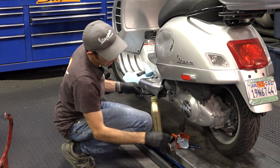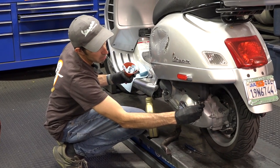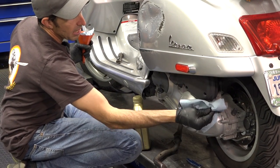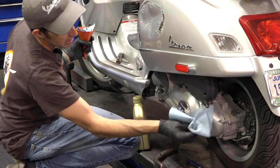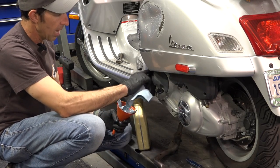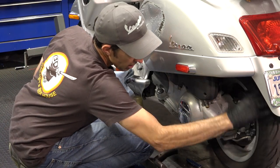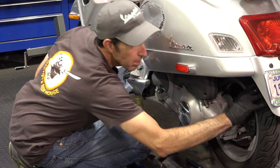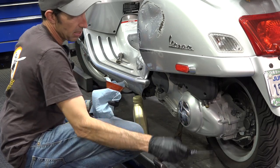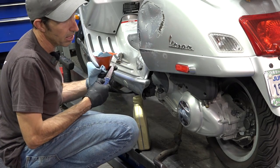I know the air filter is fine. You always see a little bit of weepage around here — that's pretty normal. Sometimes you pull that off if there's any blow-by. I'm not riding the scooter on the freeway that much so it's not really an issue. If the scooter goes on its side it might put quite a bit of oil into the airbox. This is a little air scoop for the belt cover. Give the tire a spin and listen to the bearings — just a little bit of normal noise, not excessive, from the bearings in the gear case or in the clutch when it's disengaged.